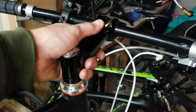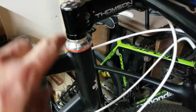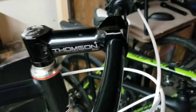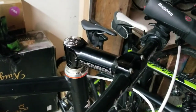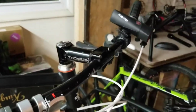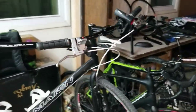Also related to standards — the steerer tube. I prefer a non-quill stem if possible. A lot of cheaper hybrid bikes have a quill stem, but this has a standard inch-and-an-eighth steerer tube with a normal bolt-on stem. This Thompson stem is off an old mountain bike of mine — it's non-oversized with a pinch-bolt clamp. I also have this really cool swept-back Nitto steel torsion bar from my Karate Monkey, which goes great with this old Thompson stem. Perfect for this bike.